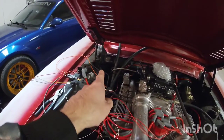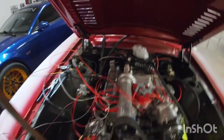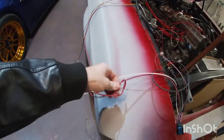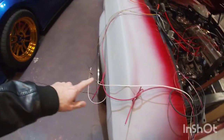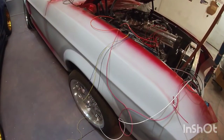I got the fuel line going out to the back for the nitrous, so I gotta finish routing that. There's a lot of wiring here — I connected the MSD pigtail for the MSD box, and most of these wires are going to be connected to each other for the fuel injection to the MSD box. I kind of routed everything that's going to be connected together and tied it like this.